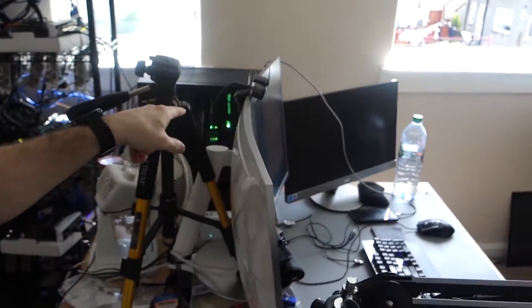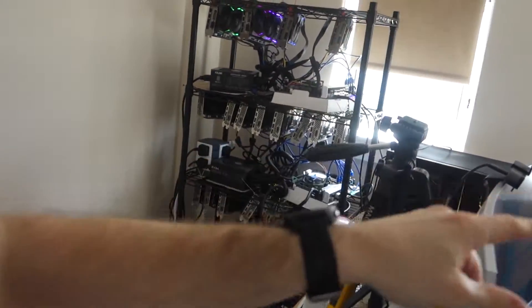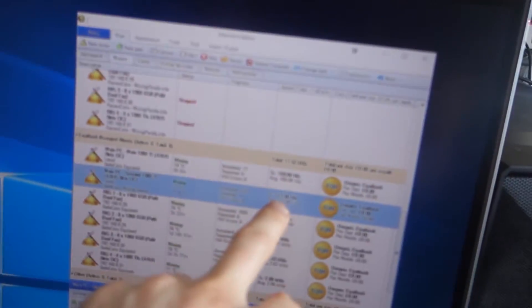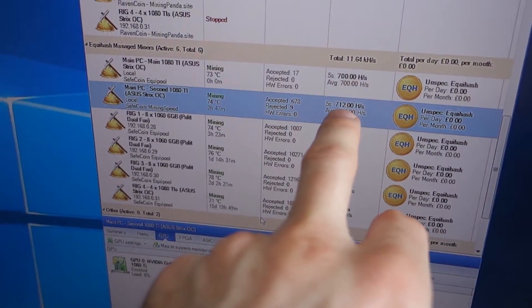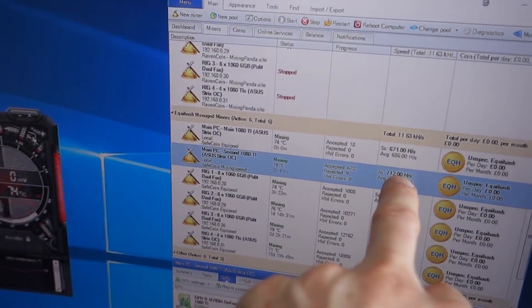So what I'm going to do now is take the 1080 Ti out of here, put it up in the open-air rig, and evaluate the temperature there — it should match the other cards. Not only will this make my room cooler, it should also give me a better hash rate. When I had it running at 85% power the temperatures weren't so high and I was getting around 740–750 sols. Dropping power by 15% dropped the sols by about 40–50. So by doing this I'll cool the room and get a better hash rate.